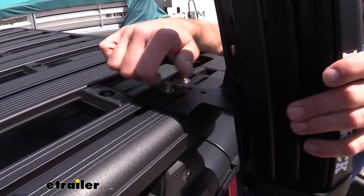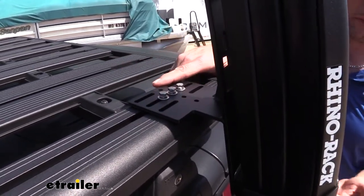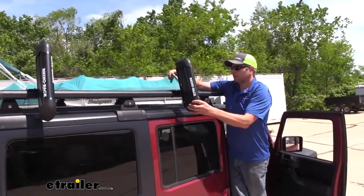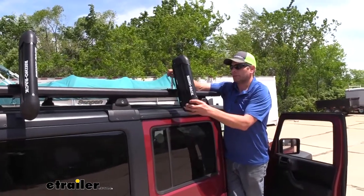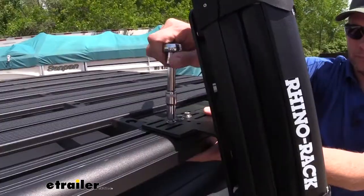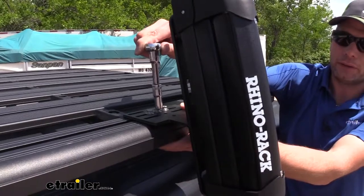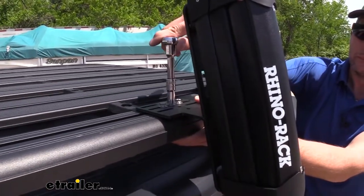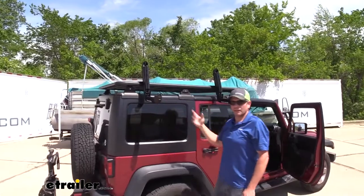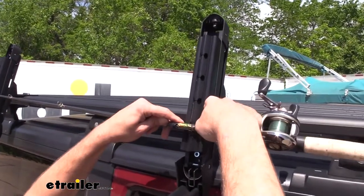You can see it's going to tilt out a little bit, so we can take some of the slack out of our bolts. We still want it to be adjustable because depending on the type of fishing rod you're going to be using or the length of your skis, you'll want to adjust it accordingly. We'll bring ours to about right there, then we can use a 10 millimeter just to secure down those bolts. The bolts are stainless steel, so corrosion and rust really shouldn't be a problem. We want those lock washers to be fully compressed, but we really don't have to over-tighten them. We got both sides assembled — just open our caps and we'll be ready to get our skis or fishing poles in there. This is a little bit thicker rod, so we'll place that in the bottom here.